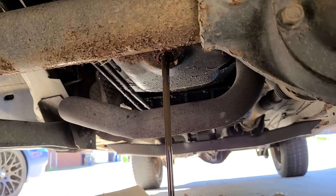I've replaced both the top and the bottom O-ring on each injector — very important. This is one of the old ones and you can see it's kind of flat, so this can cause a vacuum leak or cause fuel to spray outside of the engine, which is no good. You guys can spend as much time as you want cleaning the outside of the fuel injector, but what really matters is the inside and new seals.